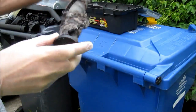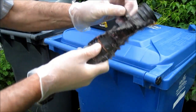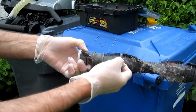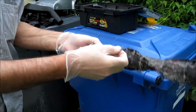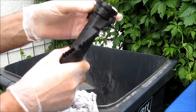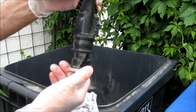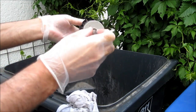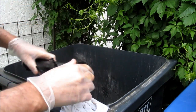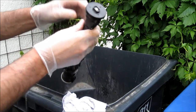Now I've got to clean the bar and get all the stuff off. This one you don't want to put into the water because there's bearings in there — you just want to give it a wiping. You don't want to try to pry this because they'll bust. It'll crack right there, so if it spins good just leave it. I tried once and I cracked the base, so I know not to take them apart — at least on this type, this Bissell. Other models you can take them apart, but this one will crack.